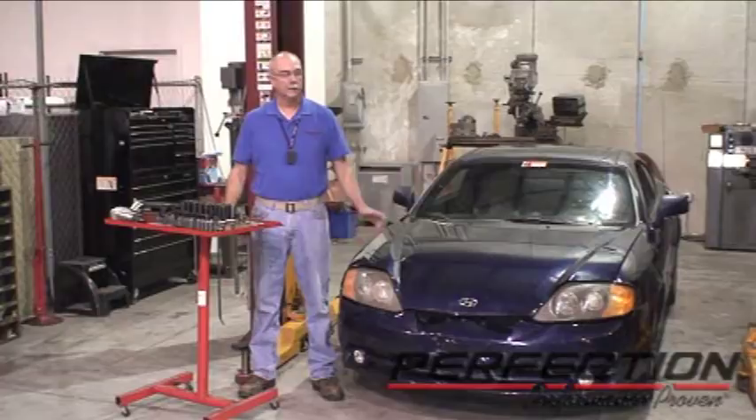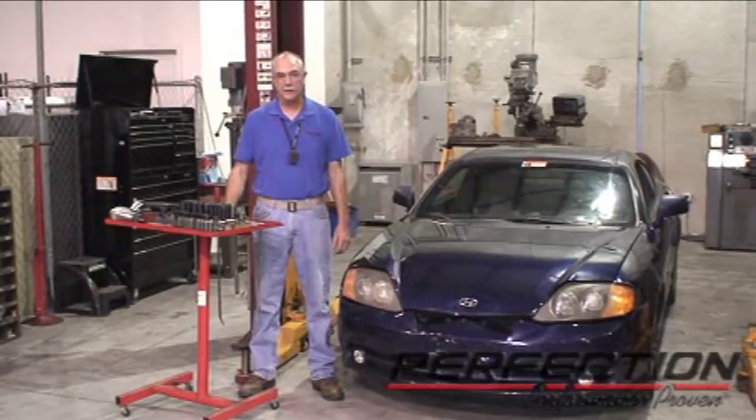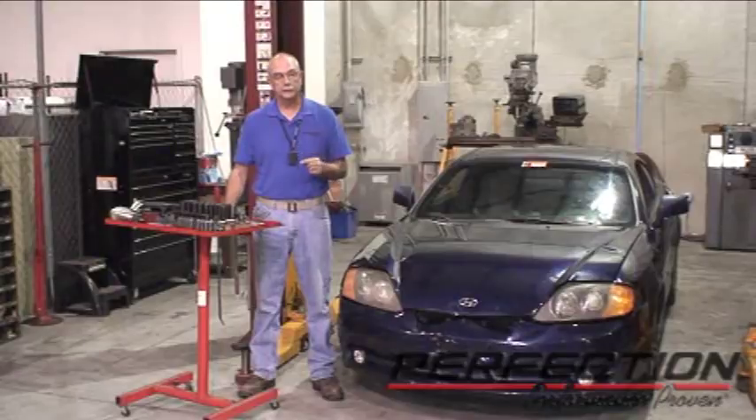Welcome to Perfection's Clutch Installation Lab. Today we've got a 2003 Hyundai Tiburon GT V6 6-speed with about 103,000 miles on it. The car was originally built with a dual mass flywheel and these use a pull type clutch. There's been many times where people have had a little bit of a problem even taking the transaxle off this engine on the Tiburon series. There's a special trick I'll demonstrate, and there's definitely a serious trick to putting the release bearing on the transaxle and then correctly locking it in to the pull type pressure plate.